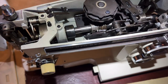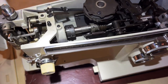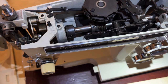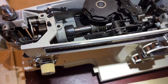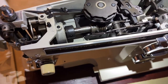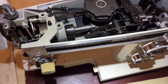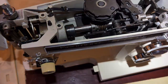You notice I'm not putting a ton of grease here - you don't need a giant blob. The gear only holds so much. Grease does not normally go flying around; it should not have to be re-greased for several years, depending on how much the future owner uses it. Oiling is something you do a lot more often. I think that's the only gear place I put grease on this particular machine, but if I'm forgetting one, one of you will remind me.